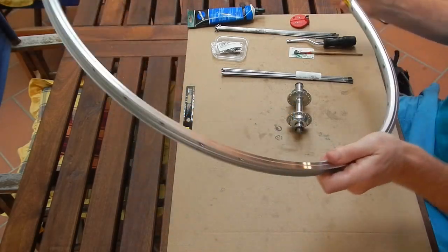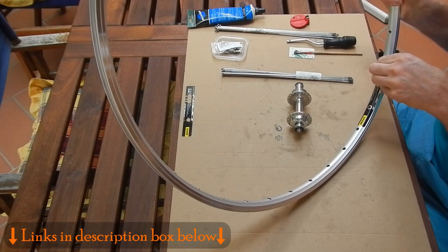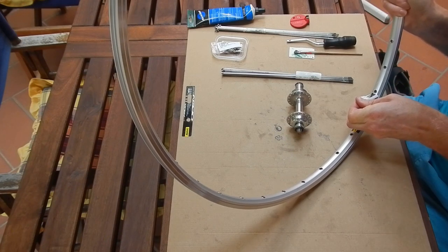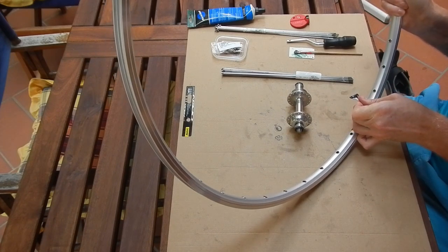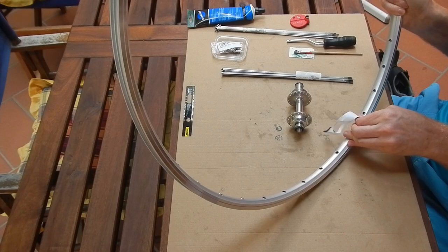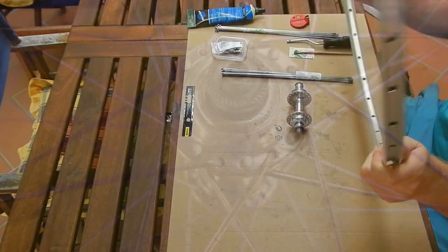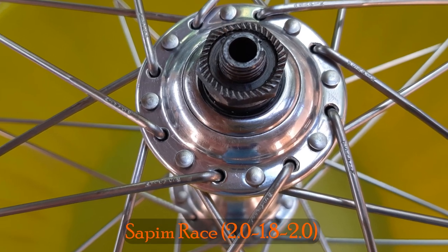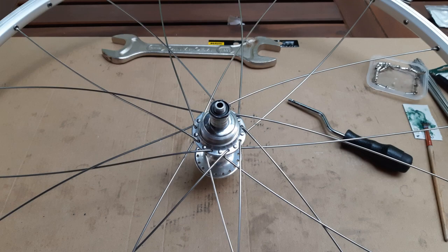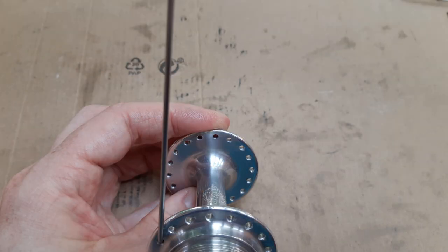I'm just an amateur wheel builder, and there are plenty of other videos on YouTube by experts from which you can learn wheel building — I've put a couple of links in the video description box below. Here I'm just going to describe some of the choices and considerations I've made for the wheel set. First, rims: I've gone with Mavic Open Elite in the silver finish. My reason for choosing these was that they are affordable, durable, and they won't look too out of place on this bike. Also, the stickers come off easy, so no one will know that they're French. Second, I've gone with quality spokes for a quality ride — I'm using Sapim Race double-butted spokes with matching silver brass nipples. Never cheap out on spokes. Third, the lacing pattern: I'm lacing both rims three cross, and I'm paying special attention to the old bedding-in marks around the spoke holes on the flanges of both hubs.